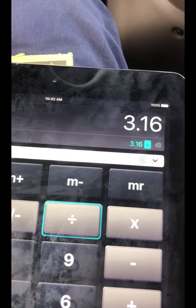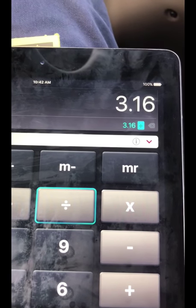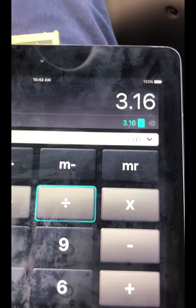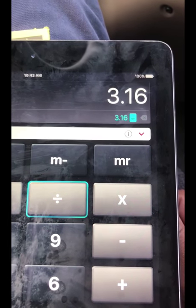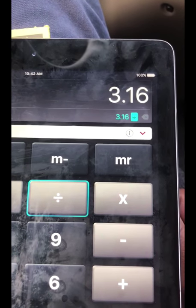And when you're sliding tandems, you always want to slide your tandems towards your problem, whichever is heavier. If it's heavier on the drive, you want to slide your tandems forward, right? If it's heavy on the trailer, you want to slide the tandems backward.